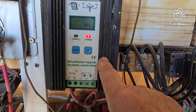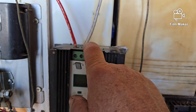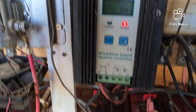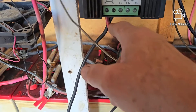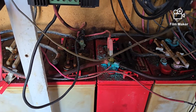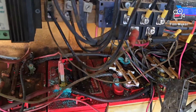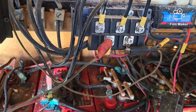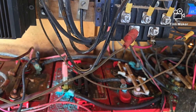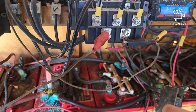This one I'm using as an experiment right now. You see the red and white wire here — I did that instead of red and black just to experiment. You can see I've got alligator clips on top. These two come off the battery, go down with battery clips, and clip onto the batteries down here. I need to get in here and clean these terminals — they're gassing off quite a bit and putting out a lot of corrosion. I even tried grease on the connectors and it didn't make any difference.